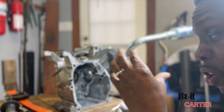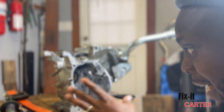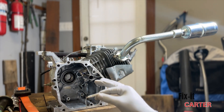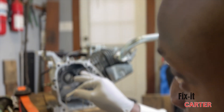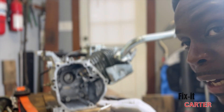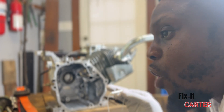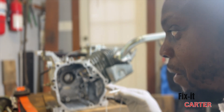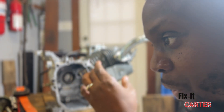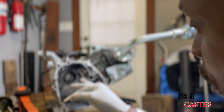Be diligent in your diagnostic procedure. If it's the crank you can get a whole kit — the crank, the rod, the piston — and just rebuild if you don't feel like doing all the diagnostic work. This was easy for me: I didn't have to take the piston out from the top, I just lowered it down to where the skirt was and pulled everything off. Just make sure you don't pull it past the rings. To reinstall, hit it in the center — give it a good whack but not too hard — and it should go down into the block without the rings catching.